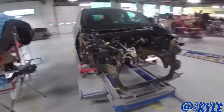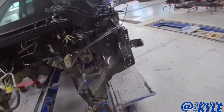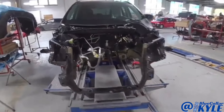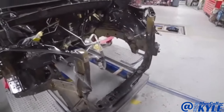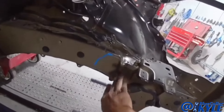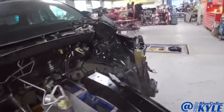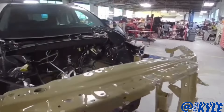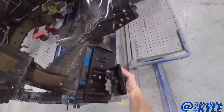It is Frame Rail Friday. I have a 2018 Toyota Highlander here. This one got smoked on this side and pushed both frame rails over — you can see they're sitting over like this. This one I'm going to straighten. I'll be able to put in clamps and do some measurements, but this side actually buckled. There's no way to properly fix that, so it has to get a new frame rail, a new radiator support, and some other smaller parts like this side plate.